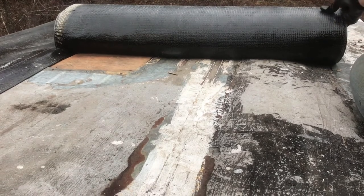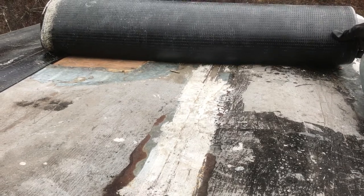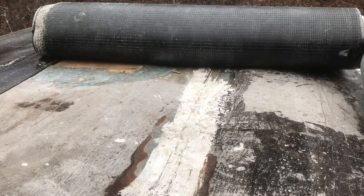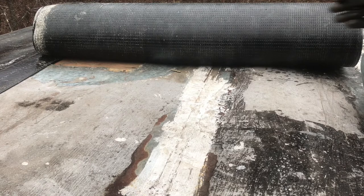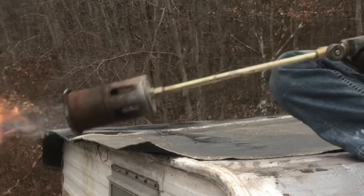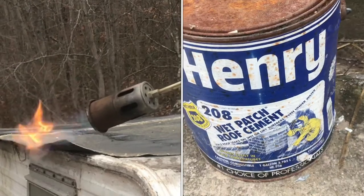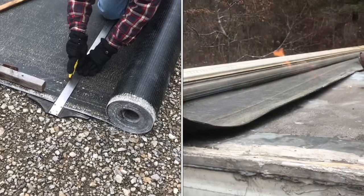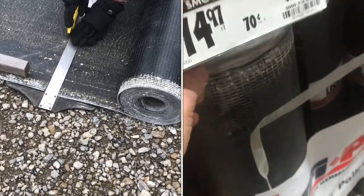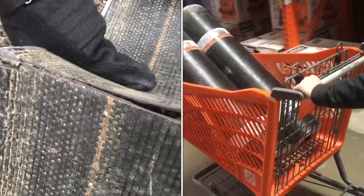Now, there's all kinds of companies that make this stuff. I'm not being sponsored by anybody here. If you're going to be putting this on your own roof, this torch down should actually be going down on some fiberglass padding. This is an old trailer, and I know this stuff sticks. There are other videos that show you how to put down the flashing and the fiberglass substrate. I always use this torch down for flat roofs. In the past, I've wasted a lot of money and time on other products. This stuff is really thick, it bonds together permanently, and the price is comparable to other systems — about 75 bucks a roll. I'm using two rolls, so that's 150 bucks to fix this old roof.